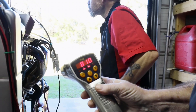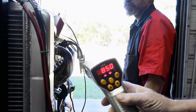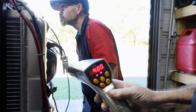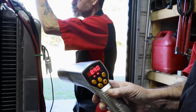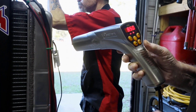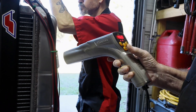It's running about 800 to 900 RPM. That's without a load, without a torque converter, and so forth. It'll probably idle somewhere between 1,000 and 1,100 in a vehicle with a load. Right now all it has on it is a crank flywheel, which is a manual flywheel — just a starting version.